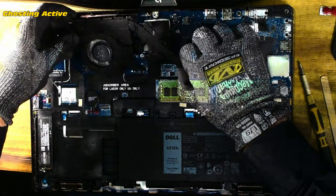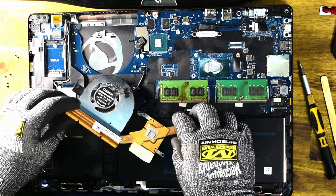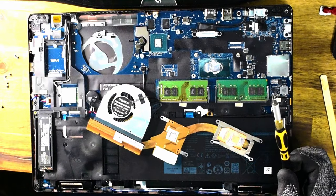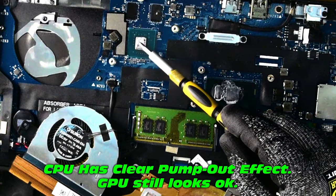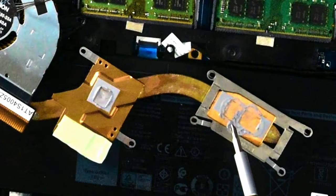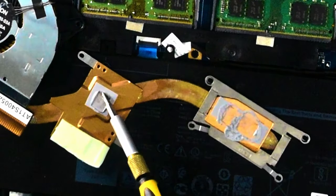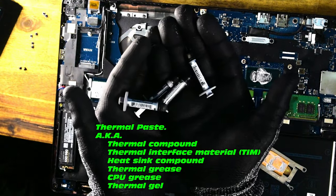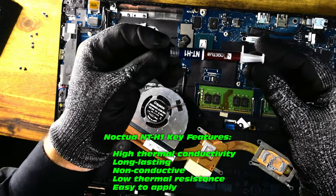It is fully attached to the PCB — we don't want to rip out the cable. Zooming in, you'll notice a little bit of pump-out effect on the thermal paste, much more so on the CPU rather than the GPU. You can see it on the copper plate as well. Not looking too bad on the GPU — in fact the thermal paste looks okay.